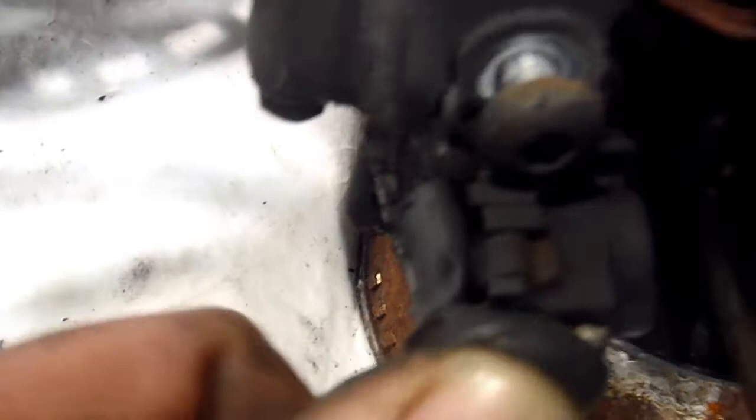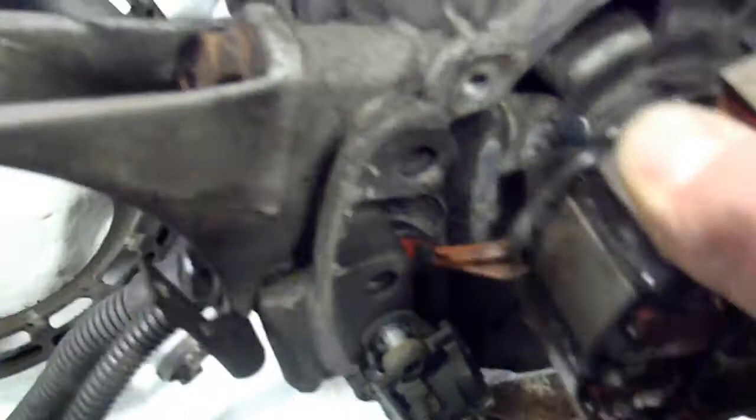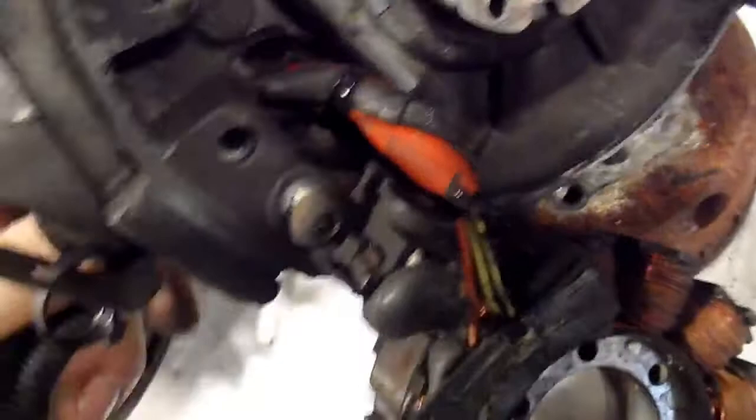On reassembly I'm going to have to reapply some glue here. You can see there are exposed wires there, so I'll have to put some new glue on that. It's also glued back here behind the stator - you can carefully get in there and pry behind. There's a rubber strip here. Work it very gently - you don't want to break a wire or short your stator out. You can see there's kind of a rubber mat that's glued onto the stator. Get a screwdriver in there and just work at it - don't get too crazy - and then the harness should fit through there.